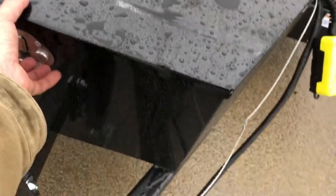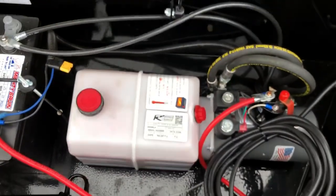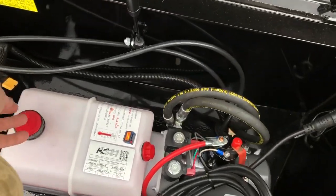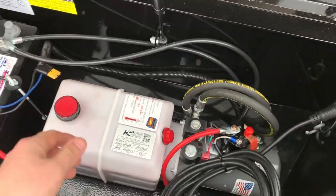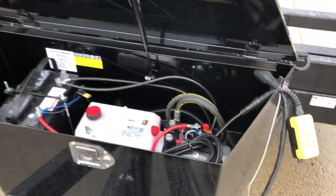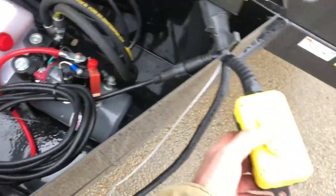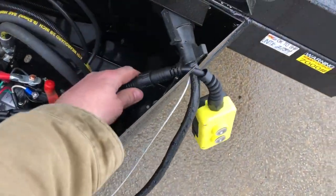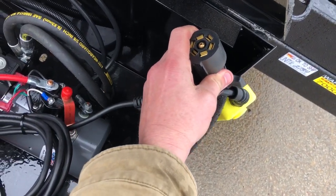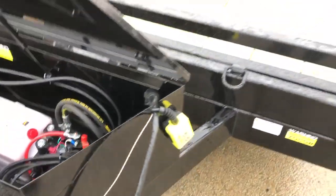This unit is a power-up power-down setup. You'll notice that from the dual solenoid. There's a Group 24 deep cycle marine battery with an in-line fuse. A gas shock on the toolbox makes it nice, and it's also a lockable box. You've got your remote cord with fob and your disconnect. They do a dual-prong connector with a standard 7-pin plug found on most modern vehicles.